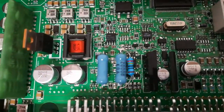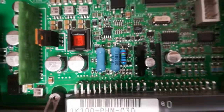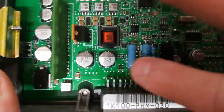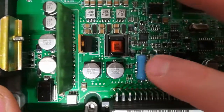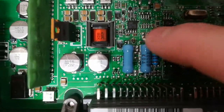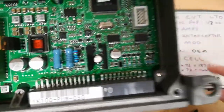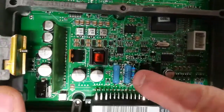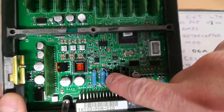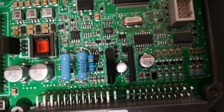The resistor simply goes across one of the blue resistors. It doesn't matter which one you put it across because they're both connected in parallel. You just need to connect this resistor across the blue resistor — that's the plus 40% resistor. If you change the setting on the MCM, you also have to change this resistor, but the plus 40% setting works in 99% of cars, so that's the standard resistor sent out with the current hack.